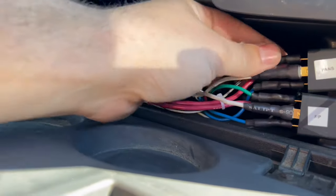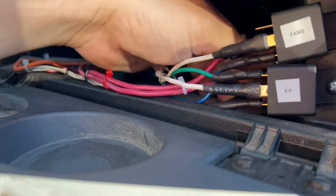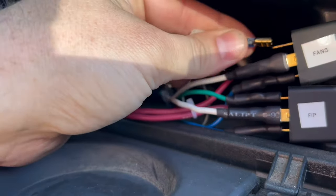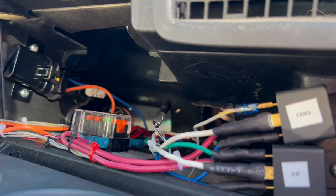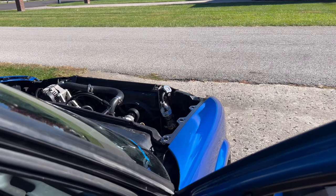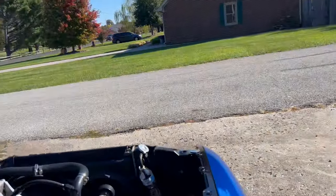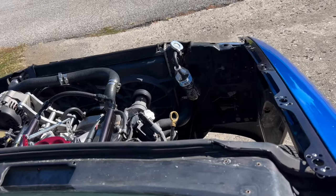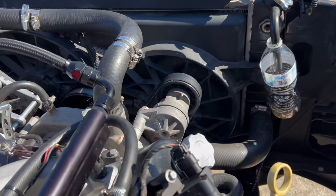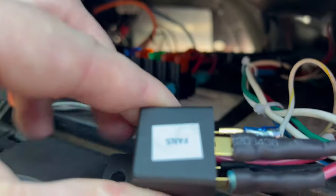I've got to figure that out. I think the trigger switch is the wrong wire, so I'm going to swap it real quick. Now when I flip the key on they should come on — and they don't. So I have to wire the relay for a ground output, which is no big deal. Two things I had wrong: the wrong output wire, and I had to wire it for the Holley giving me a ground output signal. Now they're working.